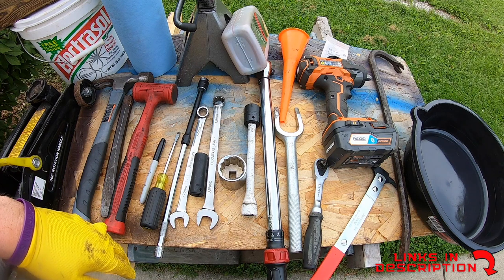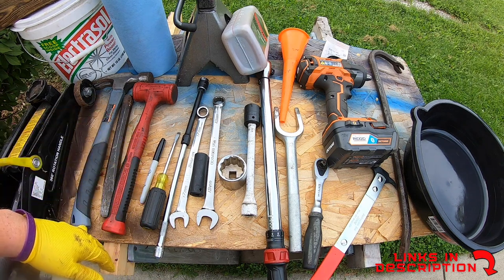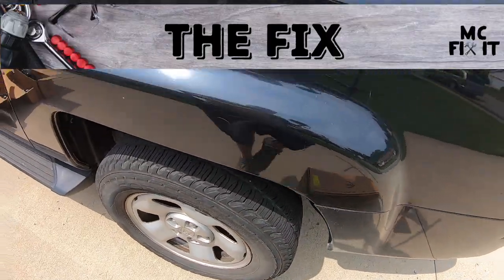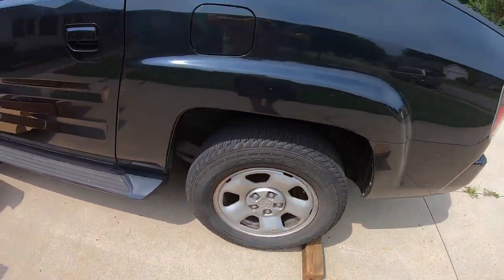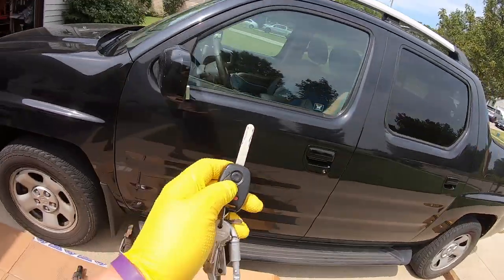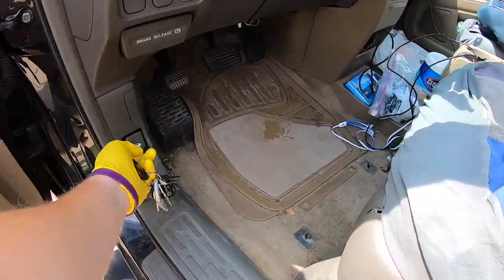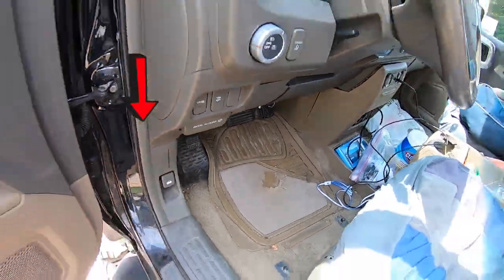Let's go ahead and jump in, getting that wheel off after we jack up the car and go ahead and get that seal replaced. I like to go ahead and put a block in right away and kick that back to where it doesn't have any rollback. My driveway does slope that direction a little bit. Go ahead and unlock your vehicle, open it up, go ahead and pop open the hood and push down on the emergency brake.